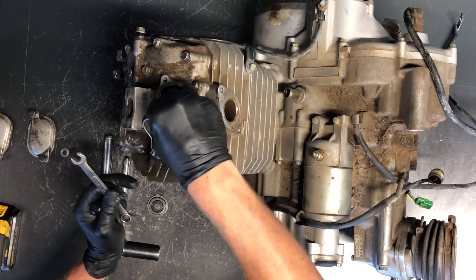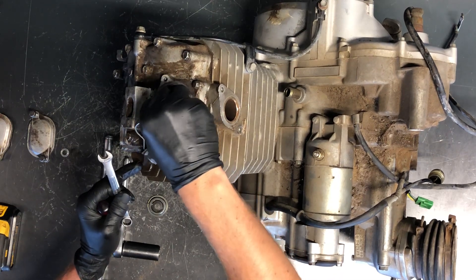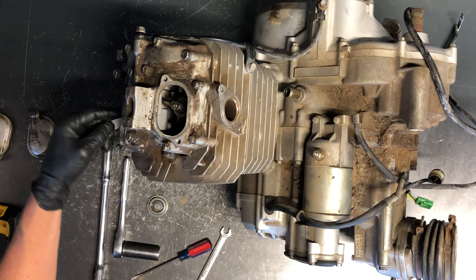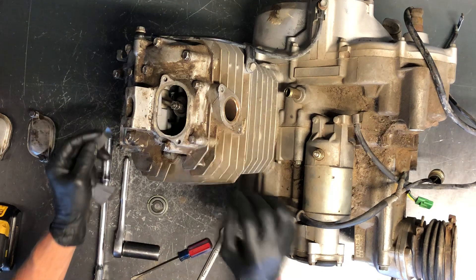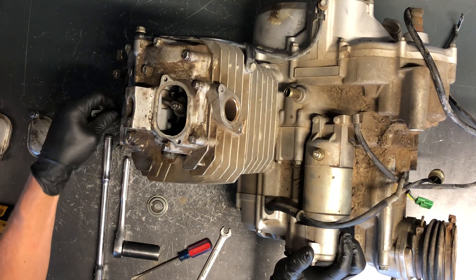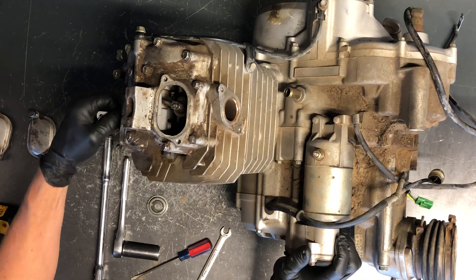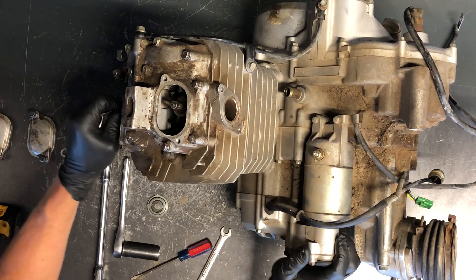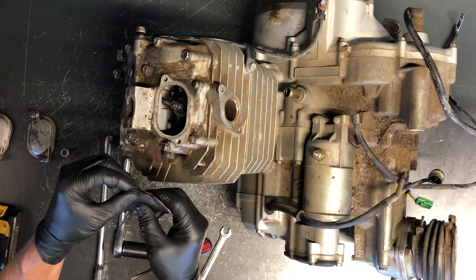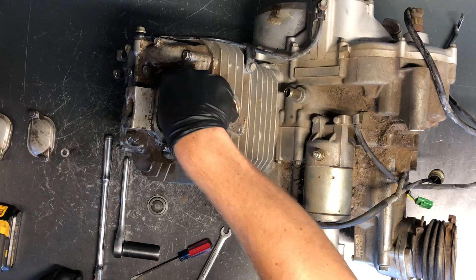Check it again to make sure it's not too loose or too tight. If you have a little bit of drag on there, that's exactly where you need to be. Valves generally get tighter over time, so if they're slightly loose that's not a major problem — though you can sometimes hear an exhaust tick. To verify, put the next size up in there: put a 0.007 inch gauge in — if you can get that in, it's probably too loose; if you can't get it in, you're where you need to be.